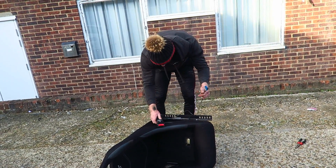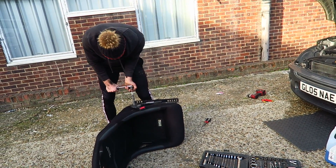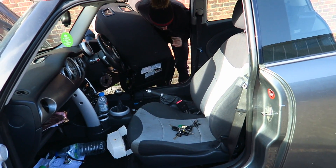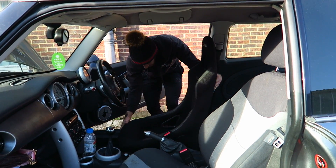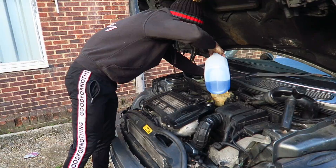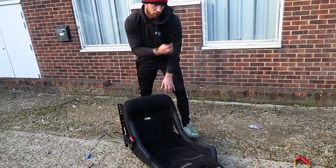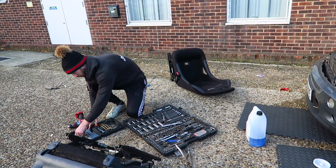We need to take this off to fit in the Mini and hopefully that fits. I'm going to need a long bolt. First bolt we found - 13mm, pretty sure it's a high tensile one as well. So that's in there, big washer on, that's bolted in. The coolant is chucking out a little bit of water but it looks mostly blue now, so that's good. We're going to turn the engine off quick. It's pretty much almost going in - I just need to drill these holes a little bit bigger. Luckily I've got the drill in the back. Doing two things at once here.